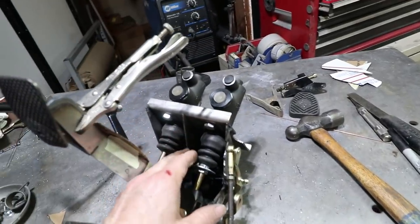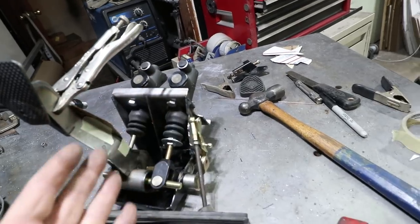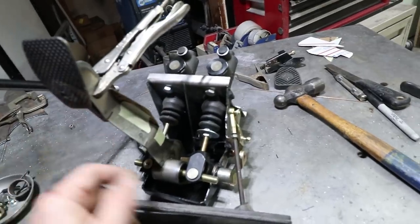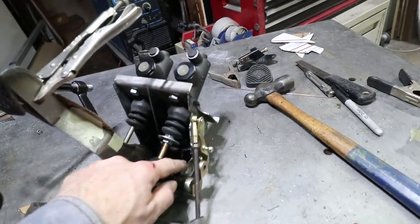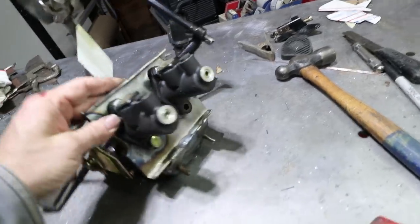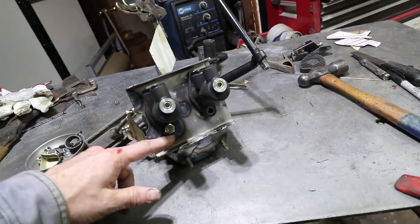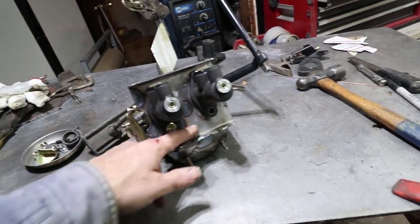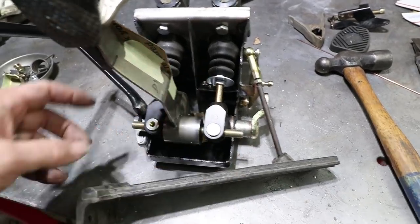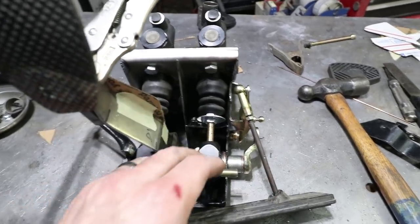All the strengthening ribs here for the pedal box are there to prevent the master cylinders from deflecting backwards. So there are these triangular gussets in three places. They tie into the original box structure. And then along the back, it has these flanges top and bottom. So this flange here on the bottom strengthens it. I'm thinking about adding another web right underneath these master cylinders, right underneath these bolts. I also added a small little shelf in here to include the brake switch. This is adjustable in terms of when the switch turns on or off.